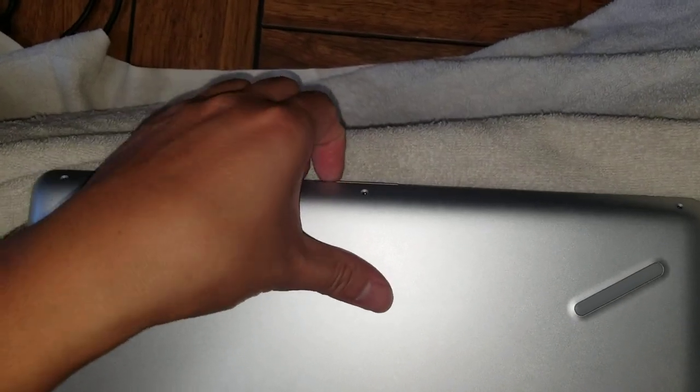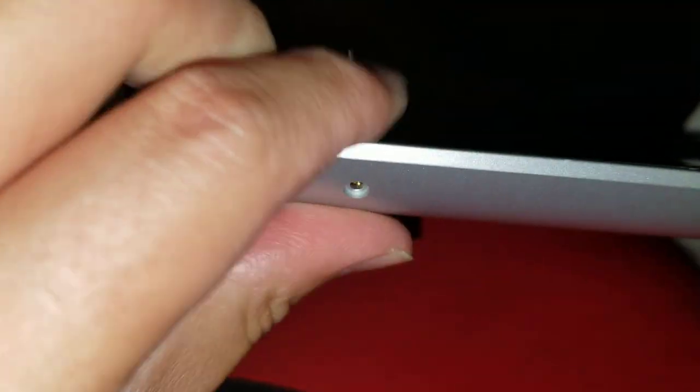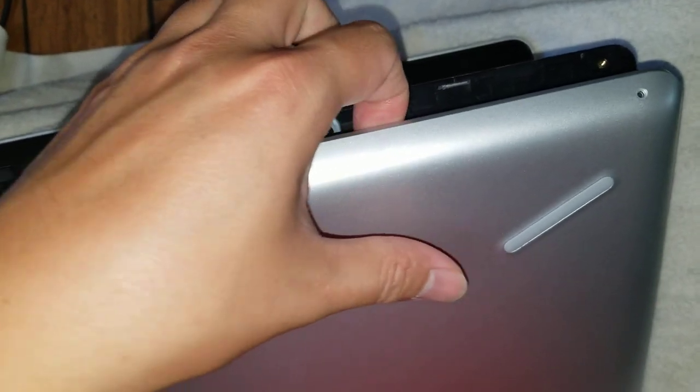Once you do that, I found the easiest way is to open the laptop slightly, so just have it at an angle like this. While it's like that, you can get your nails between the edge here — these will be clipped in place. I opened it just to make it easier to show on video. Basically, you get your nails in between those cracks and just pull on that while you're pushing with your thumb here, then just go all the way around.